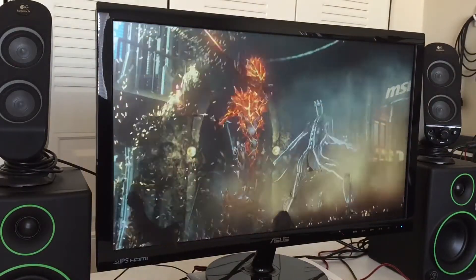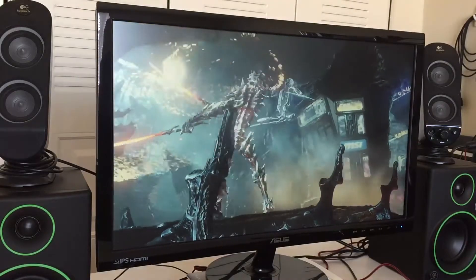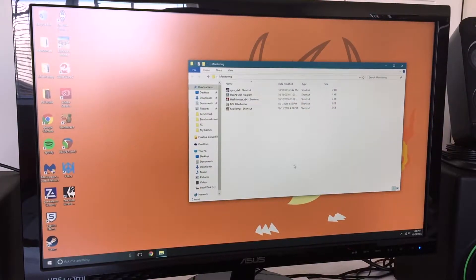After running all four benchmarks and stress tests, my system is good to go. Another way to verify stability is to actually do your workflow — play video games, edit content. I found that when I maxed my GPU at +200 core clock and +600 memory clock it passed all tests, but when playing Guild Wars 2 I started seeing artifacts and eventually my computer crashed. I clicked back my GPU a couple notches and everything was fine. The best stability test is to do your actual workflow.